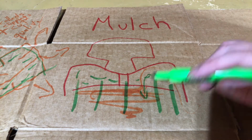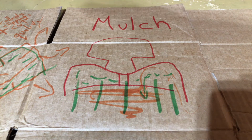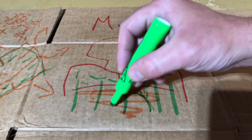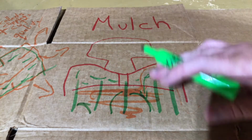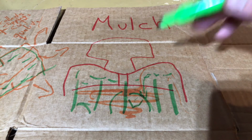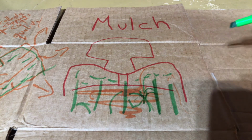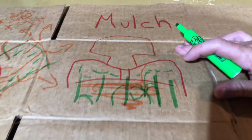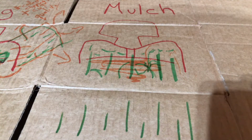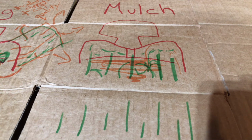They do have an opportunity to be recut. And so you get finer clippings with this method that are returned back to the lawn. Some of the negatives of this: if you have grass blades that are naturally bent over, this vortex is actually going to push those down even more and miscut them. And some that are even standing up, if they're not very thick bladed and rigid, will get pushed over and missed in cutting. So this type of cut normally leaves a pretty ragged cut when we're talking about the overall evenness of grass blades after mowing.